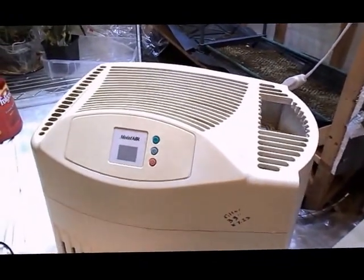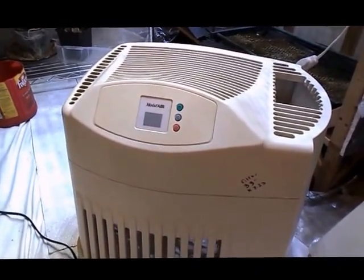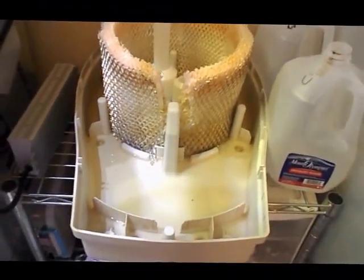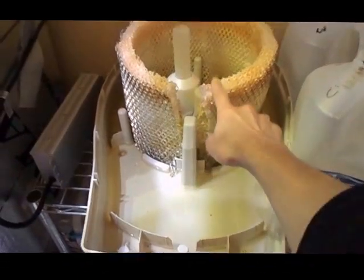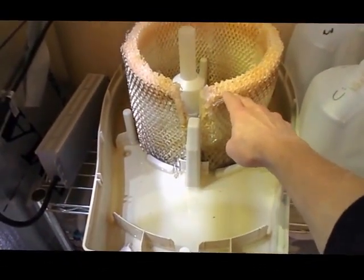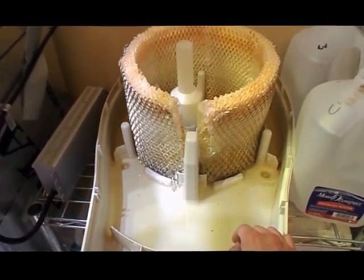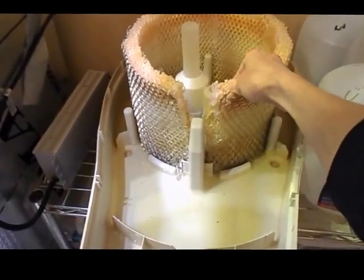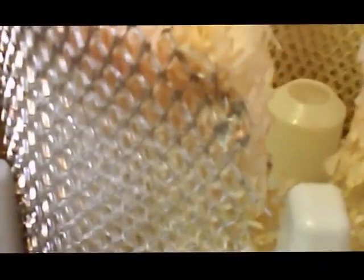So finally I bought this — it's a four-gallon evaporative type humidifier. You don't see anything coming out of it because the way it works, you put a wick in the humidifier. This is where the water goes, and your wick goes in here. This is a pretty big humidifier. The wicks cost depending on where you get them from like six-fifty to ten dollars. If you use pure water they last pretty long, though they do eventually get clogged up with mineral salts. Once they start getting clogged you can flip them over and get a little bit more time out of them.